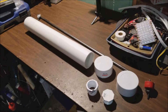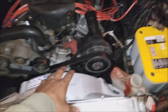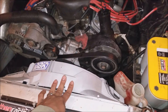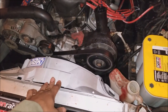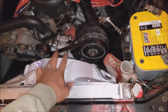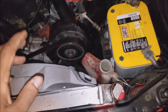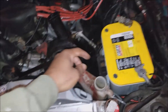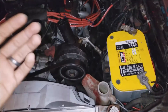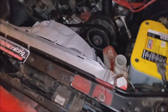I'll show you why you may have a need for an aftermarket expansion tank. I converted to an electric fan — a lot of people do this, it's similar to the Ford Taurus fan. Once you convert to an electric fan you're not going to have space to put your expansion tank. Originally when I did this swap I had an aftermarket expansion tank here and it was way too small, which was contributing to my overheating issue.